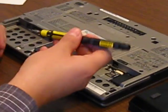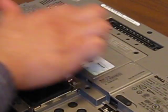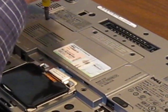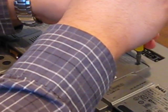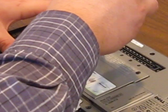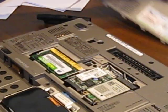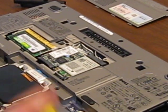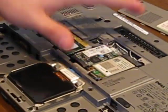Now for the old laptop, you want to take out the central cover that has the Windows XP Professional logo on it. There are three screws. It should pop right out, or be difficult, depending. Of course you will need a Phillips screwdriver — preferably one where the Phillips head is fairly small to fit the screws. But the screws on both laptops will be the same, so if they fit on one, they'll fit on the other. So that's how you take off the cover on the old laptop.